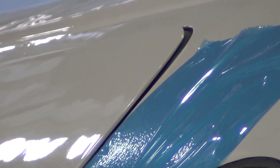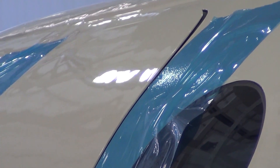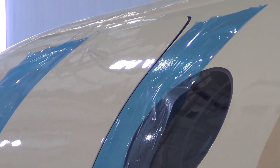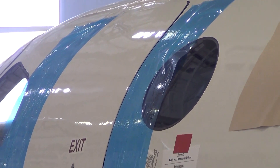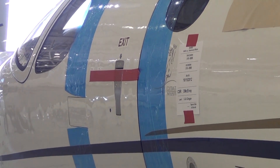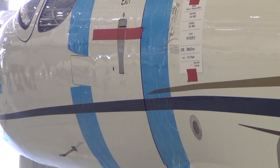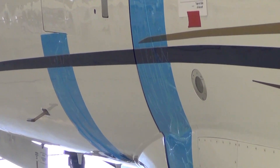This is normal as the cabin pressure is pushing out on the door. The key here is that the cabin door seal is not leaking. If leaks are noted, additional maintenance will be required on the cabin door seal. This extension is noted typically on the upper and lower aft side of the cabin door. Again, this is normal during the ground pressurization leak check.